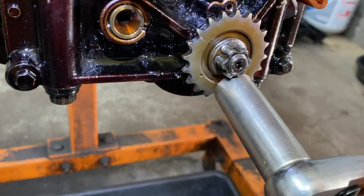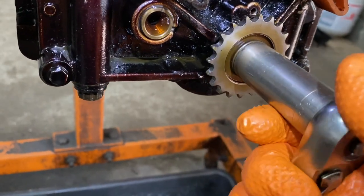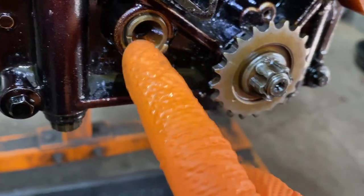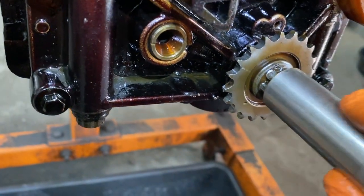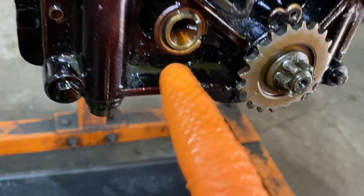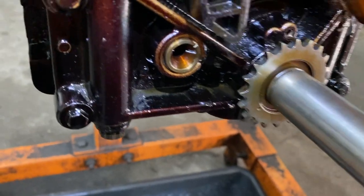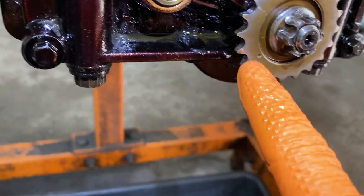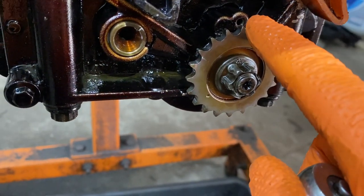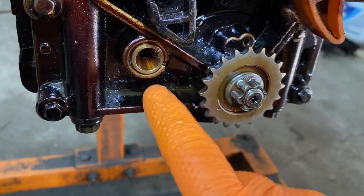If you turn this — let's say you didn't know about that, not watching my channel — you think okay I'll line it up mark to mark, you're good to go. No. You can turn it again, it takes about three or four times to line that up. How it ideally has to be: this timing mark has to align with this mark, and there's going to be a little pin — a little tool they want you to put in there, but you don't have to. You have to get this mark in line over here.